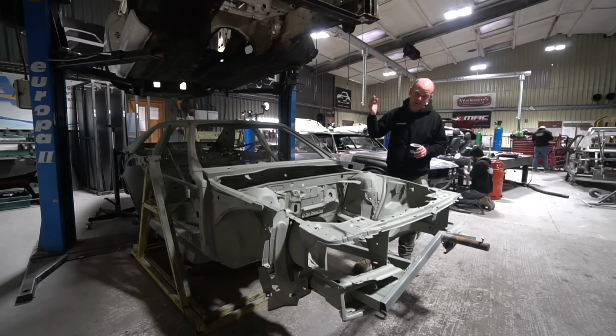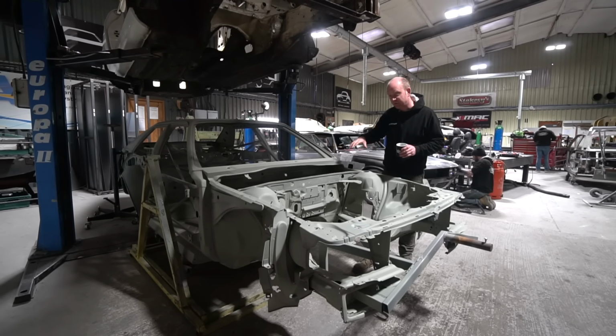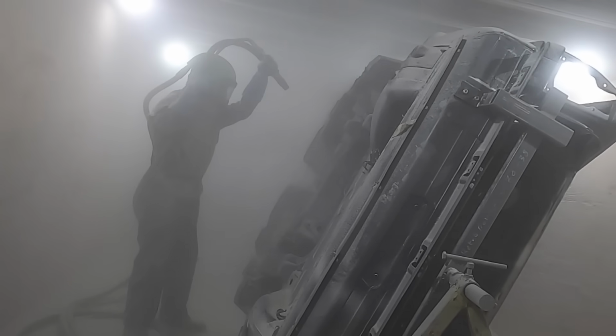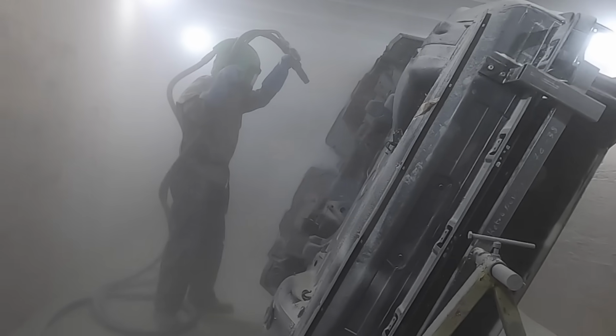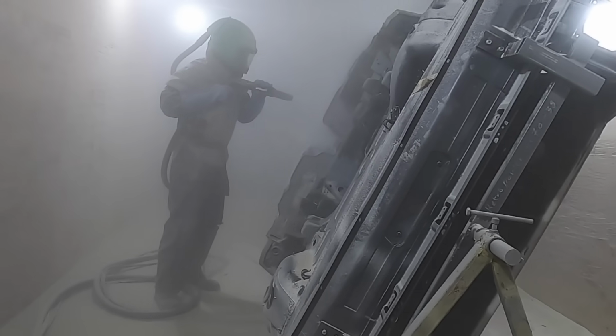Remembering that our blasting setup is in commercial blasting terms isn't that powerful, but in terms of automotive blasting, it's a pretty powerful setup. It's pretty capable of removing coating, removing paint, and removing rust. It pretty much removes it as fast as you can move the nozzle, whereas removing that sealer, it's painfully slow and just totally the wrong process. So that was worth me doing.